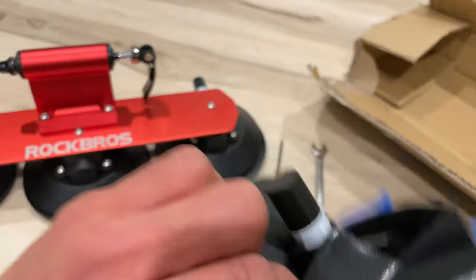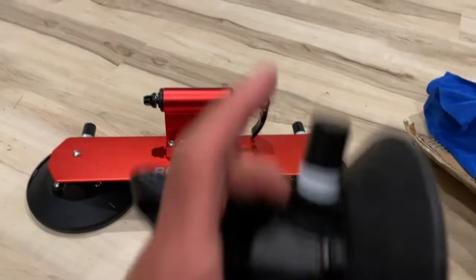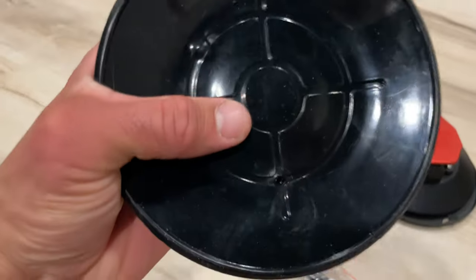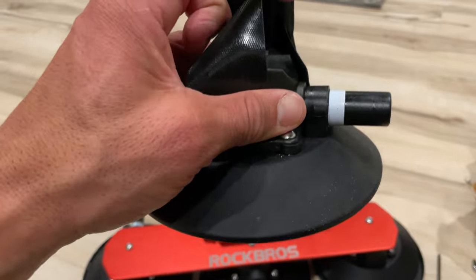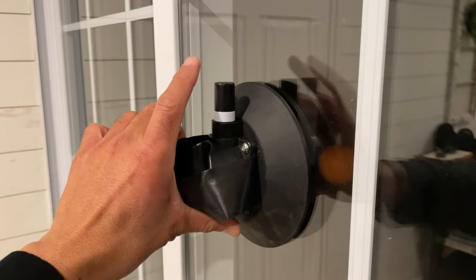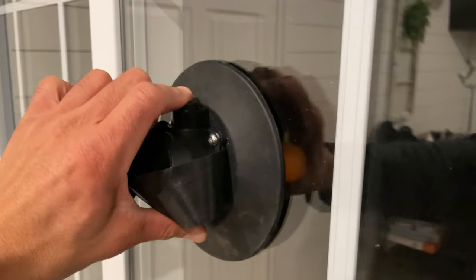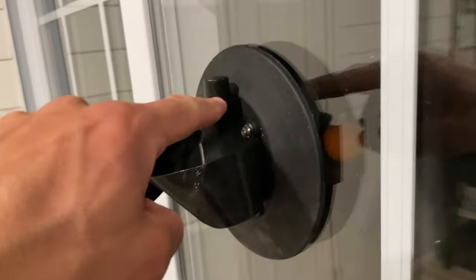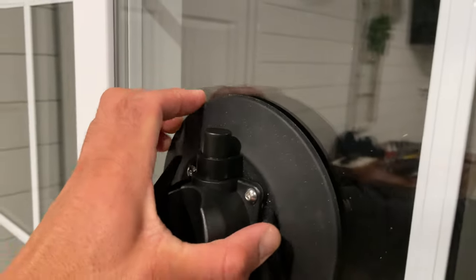If you're not familiar with how this suction cup bike rack works — I know it sounds sketchy — what you do is mount the suction cup onto the top of your car, or the glass or back window, and pump this little handle. It takes the air out from the hole, pushes down on the suction cup, and locks it on. So let's see if it works on the back slider. I put it on the clean glass and pump — about 20 pumps until you can't pump anymore. When the little white line is gone, it's properly seated. It is definitely on there.